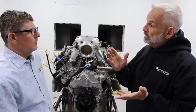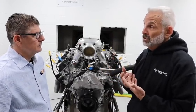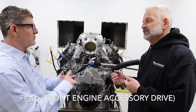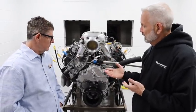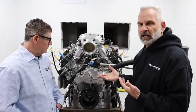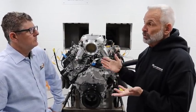Breaking that down: the difference in atmospheric correction conditions is over four percent. Induction and exhaust losses are on the order of six to seven percent for a good vehicle — some could be substantially more. Then there's the electric water pump — no parasitic losses at all, not driving any accessories — that's probably around 10 horsepower worth. And we ran this with premium 93-octane pump fuel with an optimized calibration, which is somewhere around one and a half percent. Add that up — six to seven percent, four percent correction factor, one and a half percent for calibration, plus the 10 horsepower — that's about 75 horsepower.